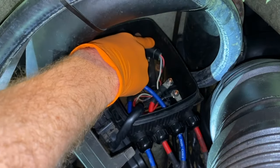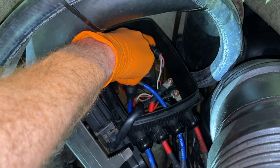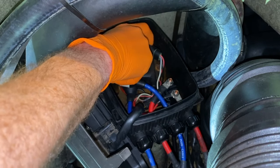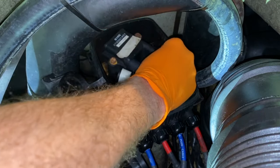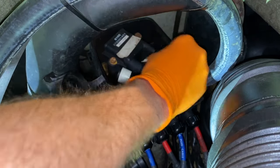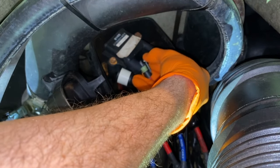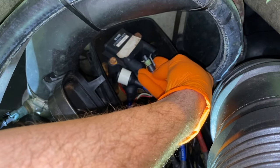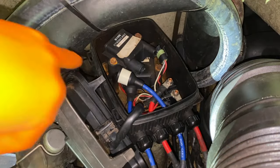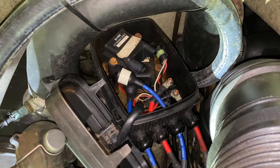Here is the inside — I'll tuck that. The next thing we're going to do is remove this electrical connection point. On the very far right side you can see a little hook — by pushing that hook out you can simultaneously pull the electrical connection out. There it is. You just pull it up and it unhooks or unlocks from the ignition coil.